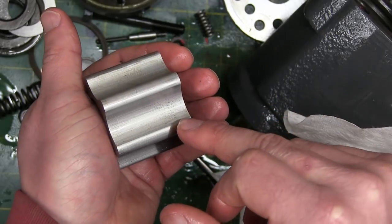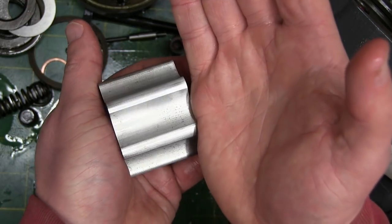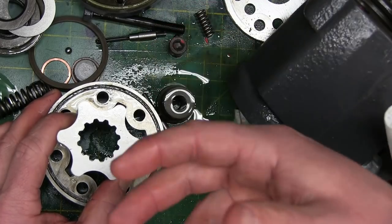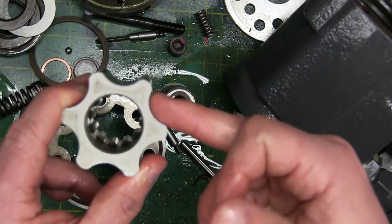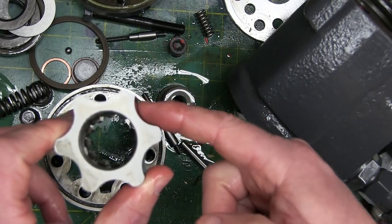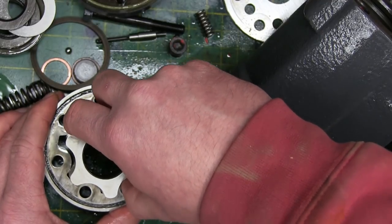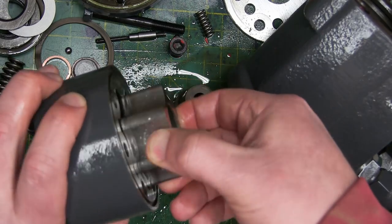This must be new old stock sitting on the shelf, because we do have some corrosion — the corrosion is in pits, almost what would appear to be EDM pits. We'll get the microscope out and check that. The fit is so tight. There's a definite transition where it's been ground on two different profiles — you can see this profile has been ground, and there's an edge right there. That edge is what actually seals it, and it's so incredibly tight. If you were off by even a thou on any of these dimensions, it just wouldn't work.